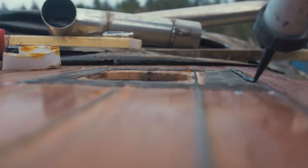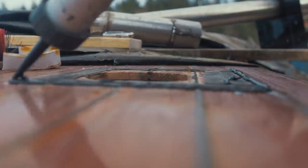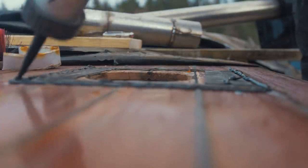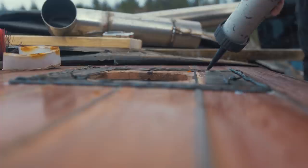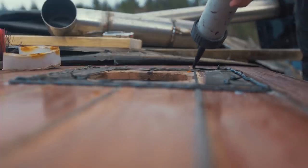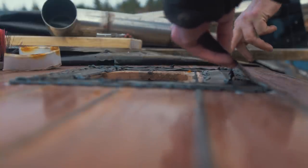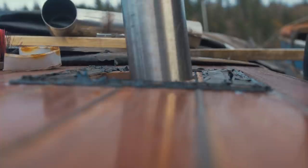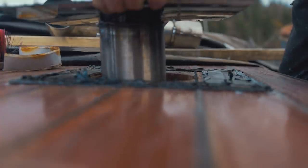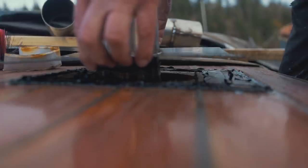And then I just wanted to go with something extra, to guarantee the waterproofness, to be sure that it was secured and there wasn't going to be a breach of water. And made sure to go with Sikaflex 291i. And I just did a few beads around the exterior, on the outside of the butyl tape. And once you screwed down the steel plate, it bulged out a nice amount, so you can guarantee that gasket.